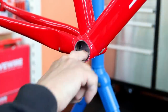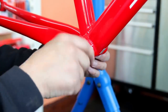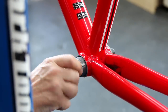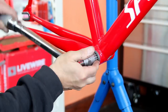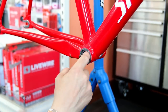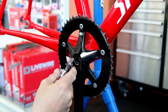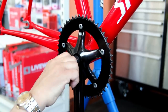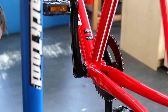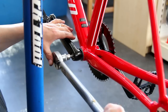Again, a little bit of copper slip on the threads for the bottom bracket — we've cleaned those threads up in the cup as well — then we get the new bottom bracket in. We use a little bit of general-purpose grease on the taper of the bottom bracket, put in the bolts that hold on the chainset, and torque those up on both sides to make sure they're absolutely spot on.